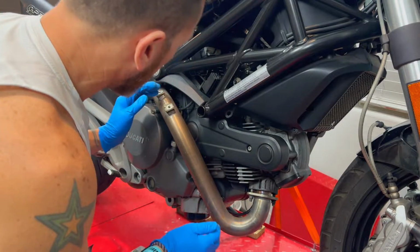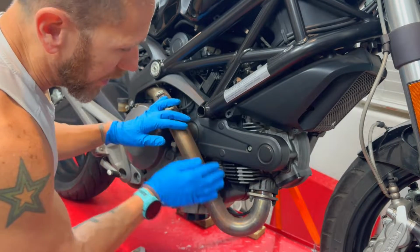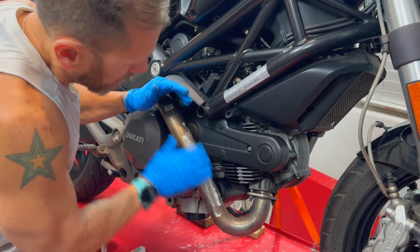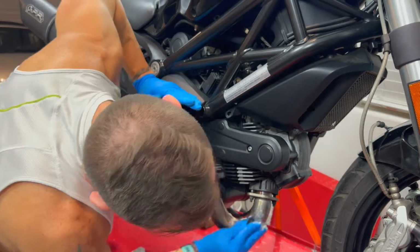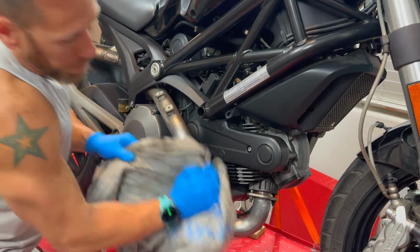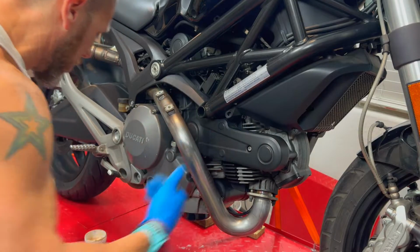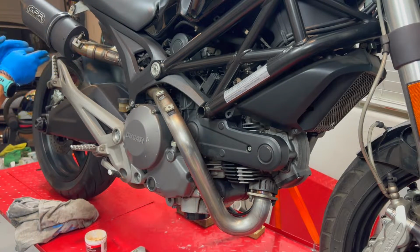I just did this on my FC, and essentially what I'm going to be doing is sanding it out with 200, and then I'm just gonna step it up to like 600, and then I'm just gonna wipe it, and you'll see how clean it's gonna look. I either put a little bit on the sandpaper or just on the pipe, doesn't matter. Now you can kind of picture how it is going to be. This is just step number one, so the effect is going to be dramatic, but then we have to continue throughout so I can clean it up.